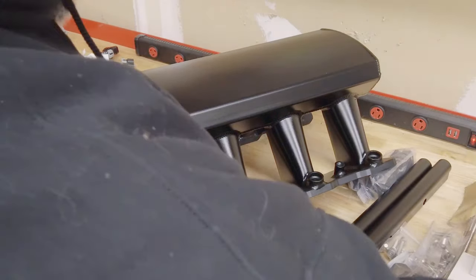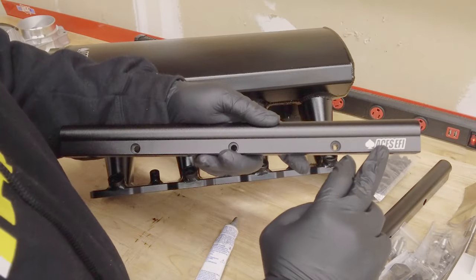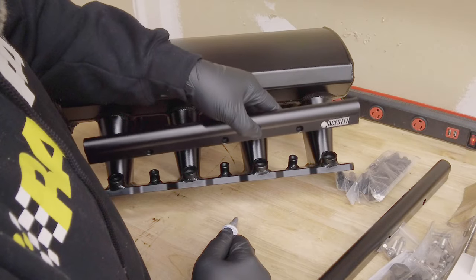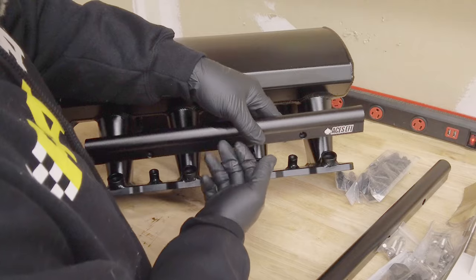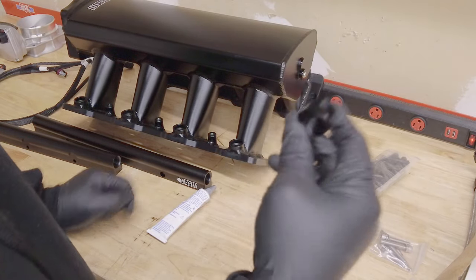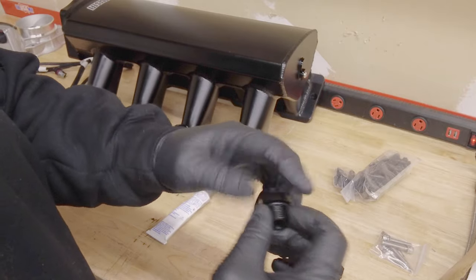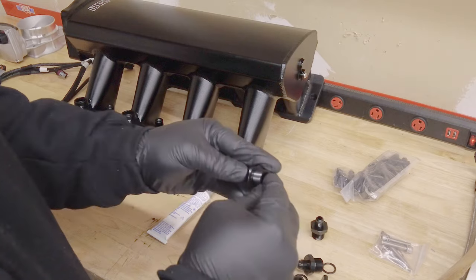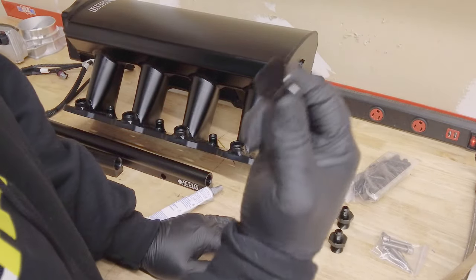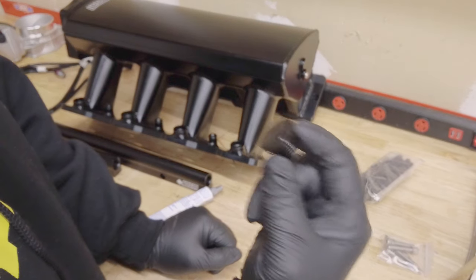You need some Allens, a little lubricant — no biggie. You've got to figure out which rails are going where. We got Aces over here so we can put it on and look real cool. You'll notice there's a little bit of an angle sometimes on these — these are going to go straight down, but this is where the Allen cap screw goes, so this is going to be outboard. Dash eight ORB to dash six — real nice. You want to get the O-rings as soon as you unbox these things. Get the O-rings and roll them on there. Make sure they're good and seated and in good health — no nicks or gouges. You want to do it to even the fittings you're not using because those O-rings will disappear on you. So we got four dash eight ORBs to dash six, and then we got one dash eight ORB plug.